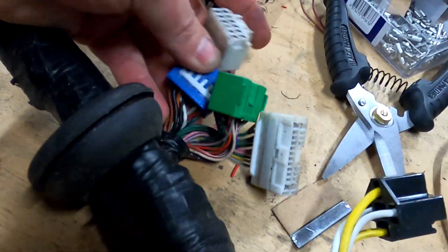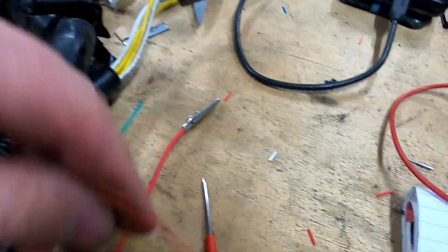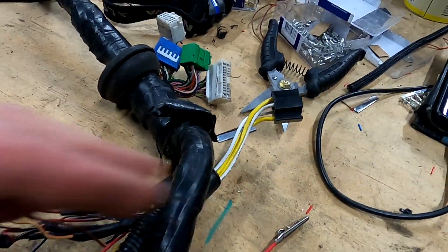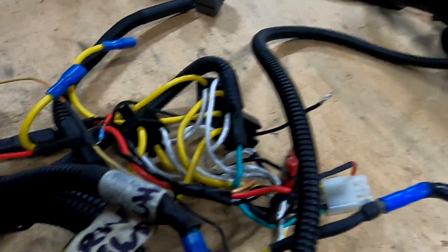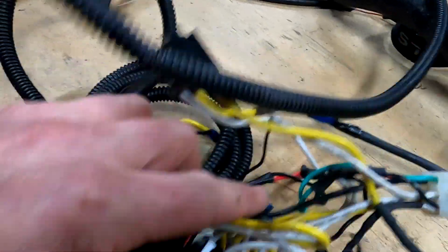There are the factory Crown plugs — none of that was removed. I sat down and went to start deciphering this stuff. I worked out that one was the water temp and that one is the oil pressure. I got those and then got into this bit and wasn't quite sure what to do with it. I went over to the car and had a look underneath. I knew this was the engine check light. Going back to the beginning, we had an oil light — the gauge on the dash actually worked. It's got the Toyota sensor in it so it must be close enough to the old Ford Zephyr one, though it had an aftermarket one fitted, which suggests the dash one isn't as accurate as we'd like.